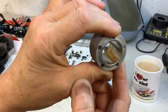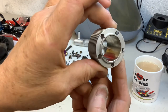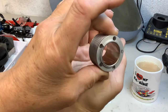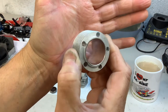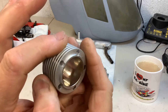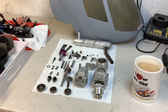It's a piston with two rings — that's what I've got to get. It's kind of wasted away in the center and it looks like it seized on the bottom of the skirt and pulled it away. There's a line going around the bore right at the bottom — I think it seized up on that. Hopefully I can get a new piston. Whether I need a new liner I don't know, because they're chrome on ally.